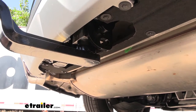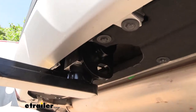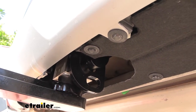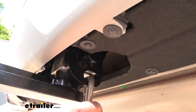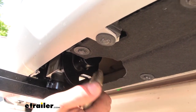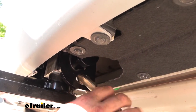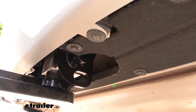When you are ready to tow, you're going to need to hook your chains up to the safety chain loops. These are tucked back there — part of that is because this is a stealth hitch and you don't want those to be seen, so you will have a little bit of trouble. But it's got plenty of room to get your standard hook, and even a larger clevis hook will also be able to get on here, though it is a little bit tight and you may have to finagle it in there.